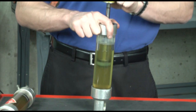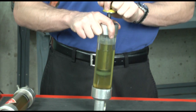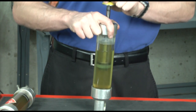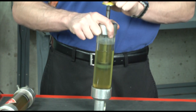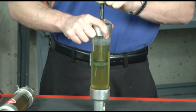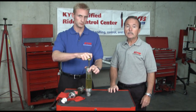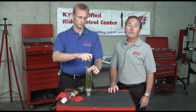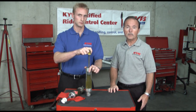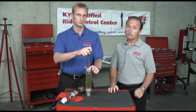The fluid is pushed back and forth between the inner working cylinder and the outer fluid reservoir. As the shaft and piston move up and down, you can see that fluid passes in and out of each cylinder. The calibrated resistance that each valve provides to fluid travel is what determines the amount of damping force that the unit will have. This basic function works well for most vehicles, especially when a vehicle is used in normal to moderate situations and when passenger comfort is most important.